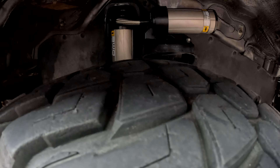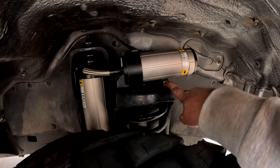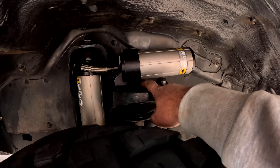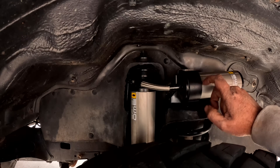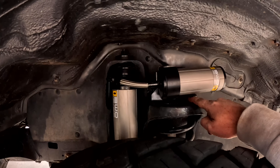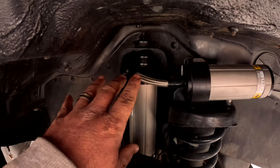Patience is taking its toll. Because we've never done this before - this is definitely something I wouldn't do again - but we've done the front right shock. It's all in. It took me two and a half hours. You've got to loosen the top spring - three bolts - put a plate on and try to get your tools back in to tighten it. That middle one needs torquing and I have absolutely no idea how they do that. Then you put the reservoir on, but there's two nuts at the back of the plate you can't get into. So I ended up taking the plate back off, screwing the reservoir shock down tight, and putting it back in and tightening the bolts up again. Now we're going to tackle the other side and hopefully from learning from this side we can complete it faster.